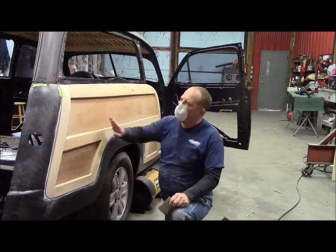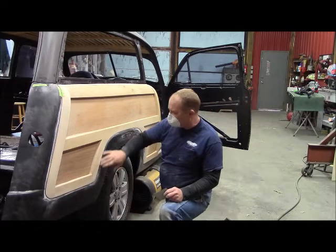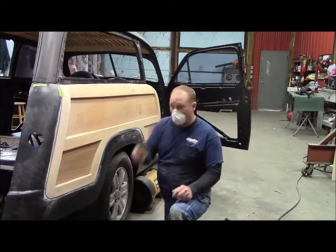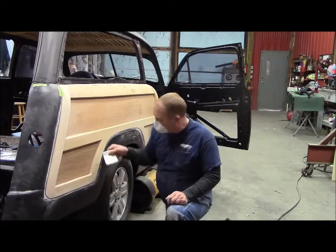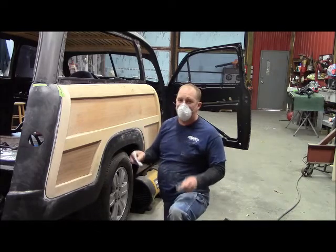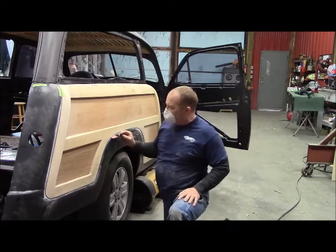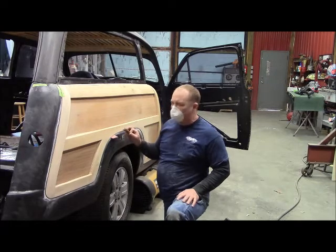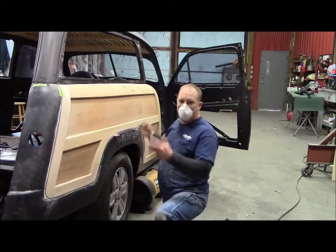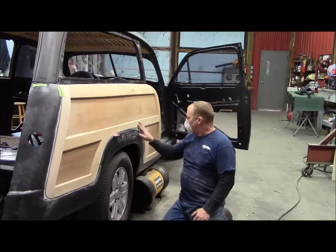Once I've got it all indexed in place, I've rolled the edges in and blocked it to the body all the way around to give me a good reveal around the edges. As I was setting it in there on and off, I was using a piece of cardboard and had already set that gap all the way around to the cardboard. Now I've gone back and put a piece of sandpaper on one side of the cardboard and I'm working that all the way around. I'll probably add a couple pieces of tape to get a little bit more — about two millimeters all the way around — and then that's going to be a perfect fit. Up here I've taken this down quite a bit and I do have an insert in here.